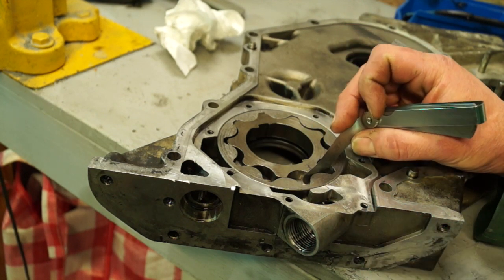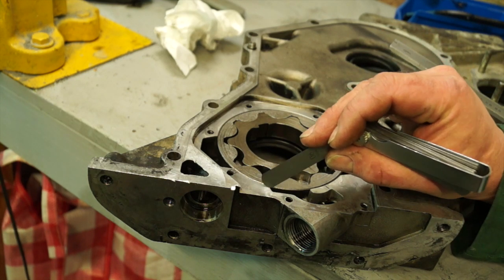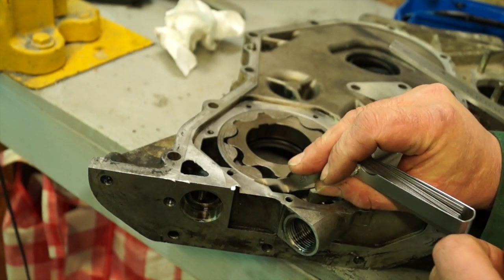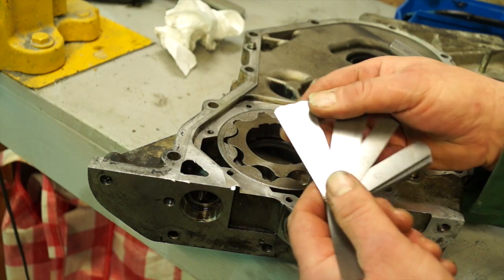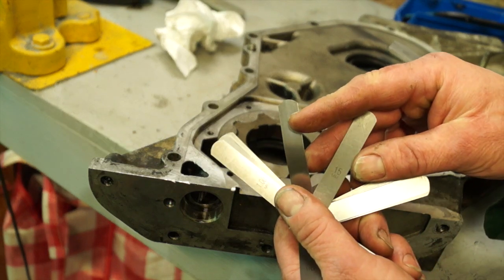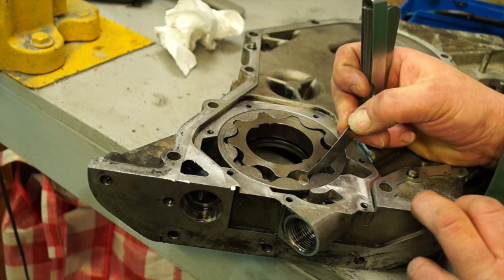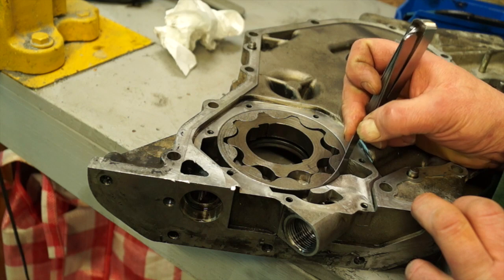The inner and outer rotors have different tolerances but both have a minimum of 0.025mm up to 0.075mm. I'll check between the inner rotor and the outer rotor — that's more than 0.08mm. The outer rotor to the rotor housing is also larger than 0.08mm. Houston, we have a problem. It's worn too much. The tolerance comes in at 0.15mm — double what it should be. With the feeler gauges we've just condemned the rotors on the pump.